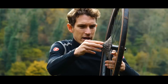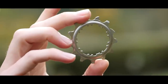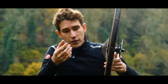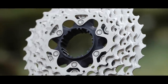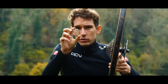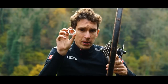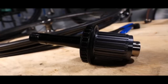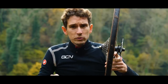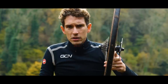The new Ultegra is 12-speed. The cogs and the spacings between them are now narrower than before, which means that the overall cassette hasn't got any wider. This is excellent news because it means that 12-speed cassettes can still fit onto old 11-speed wheels and also indoor trainers. However, if you look inside the cogs, you'll see they've actually got many more splines on than the old 11-speed cassettes. But it is backwards compatible. On new 12-speed freehub bodies, it increases the contact area between freehub and cassette. As a side benefit, you'll be able to see at a glance which sprockets are 11-speed and which ones are 12-speed.